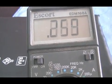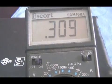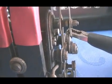So that's coil shorted and that's coil open, simply just by doing that. When you actually crank it, the movement of your hand — because it's not perfect — opens and closes these points.